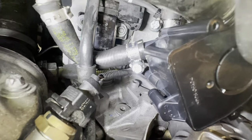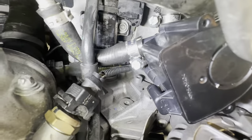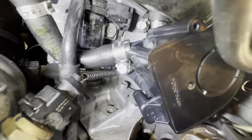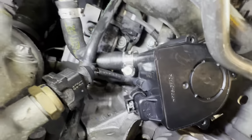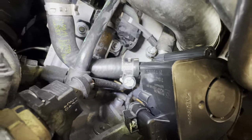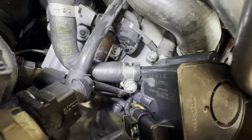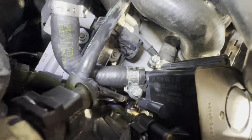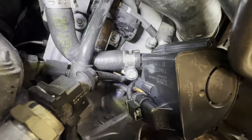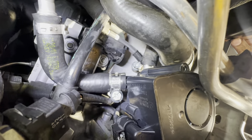I'm going to start the bleed procedure. While it's bleeding you can see my clamps — don't tighten these too much, just barely tighten them, because if you over-tighten them you're going to leak since it doesn't make a perfect circle. Check for leaks while it's bleeding and connect the bracket while it's doing that. The bleed procedure is running right now — the belt is still off the car because I wanted to check for leaks. You can hear the pump running but there are no leaks — that's a good sign. Now you can start putting the belt back on and the bracket for the pump. See how quiet it is now — before it was all loud as the bearings inside were shot.